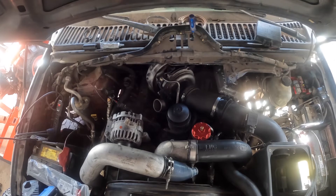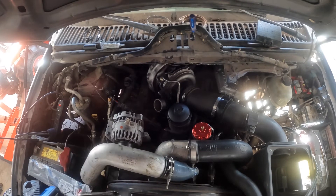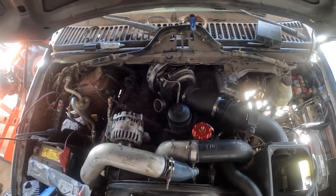Let's do the electrical injector test again. One, two, three, four, five, six, seven, eight — eight clicks. It does it around three times. As you can see, one of the new injectors was bad.